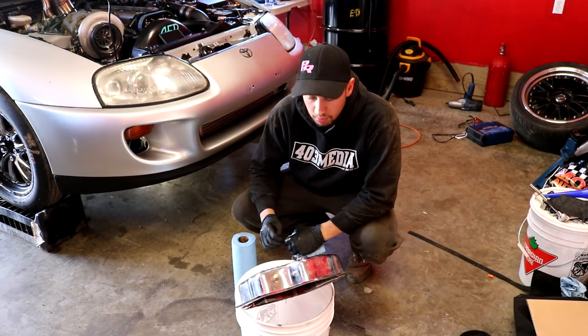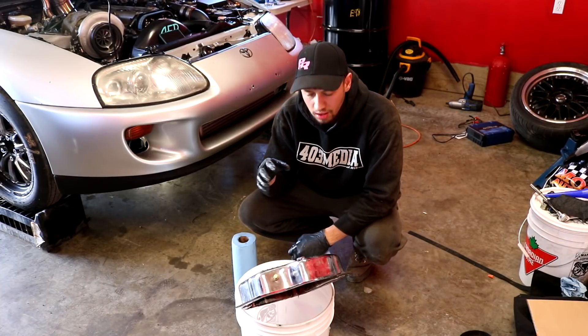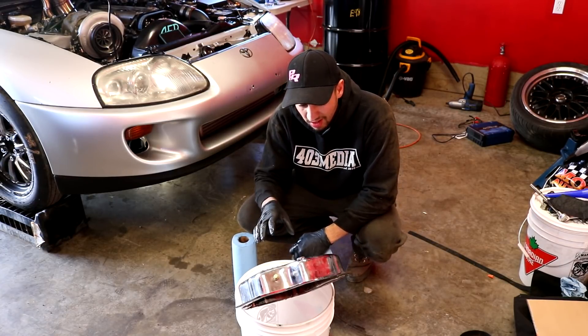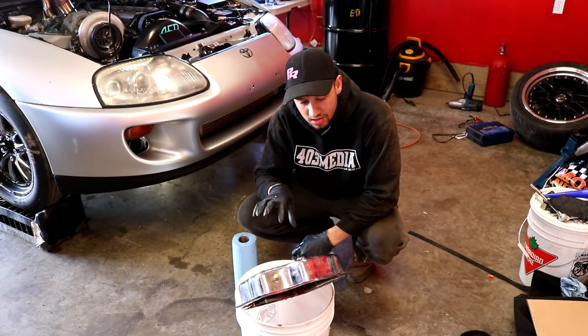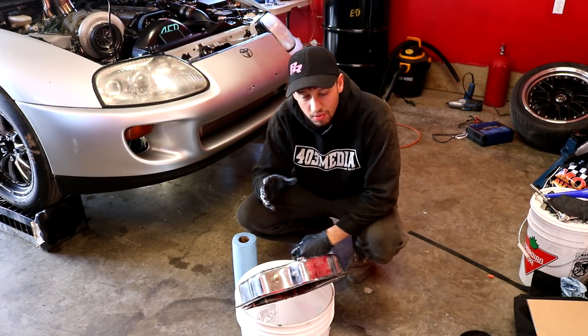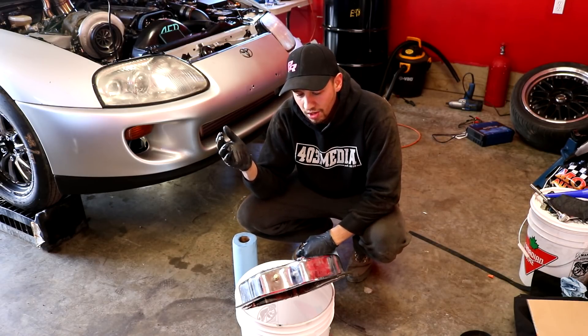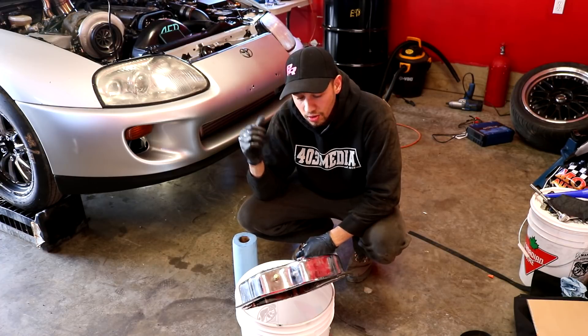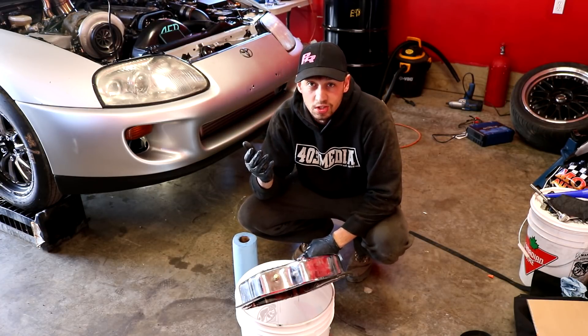What I plan on doing is simple — I'm just gonna use a brand new gasket and skim it on both sides with RTV. I do plan on getting a better cast pan like you guys recommended instead of this sheet metal thing. But I don't want to put any more money in the car this year, so this pan is gonna do for one more rental. I'm just gonna make sure it seals up.